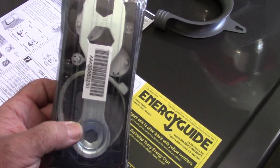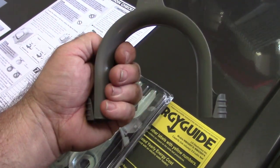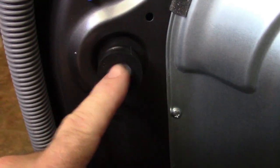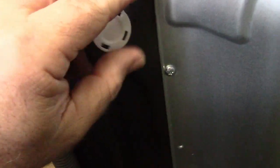Here's the little tool kit: a wrench, a zip tie, the hole plugs, and the piece that directs the drain hose. Using the wrench to remove the shipping bolts — those bolts connect to the internal drum of the washing machine to keep everything from moving during transit, so it's really a good thing they do this. Get those out of the way and move on.